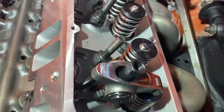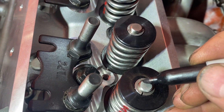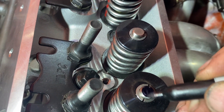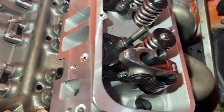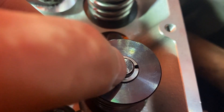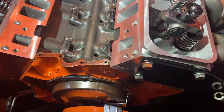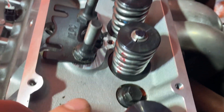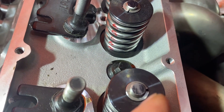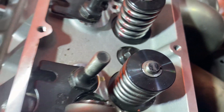What you do to verify that is take a black marker — a Sharpie — and color in the valve stem. Then you run the engine by hand a few times around, and it's going to leave a mark where the roller is. This one's a little worn out with my finger, but it was right dead center where the wear mark is in the Sharpie. If the pushrod is too long, it's going to be more towards the exhaust side. If it's too short, it's going to be more to the carburetor side. So you can adjust accordingly.